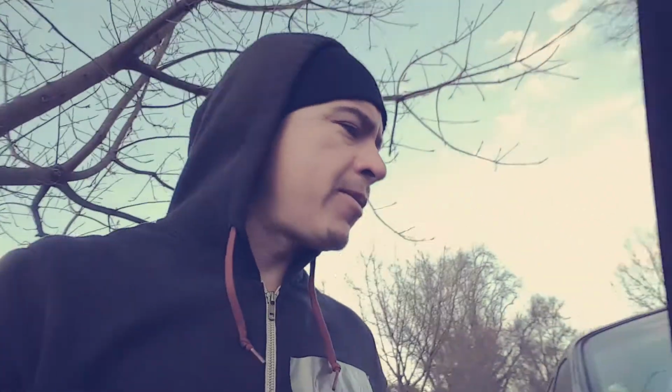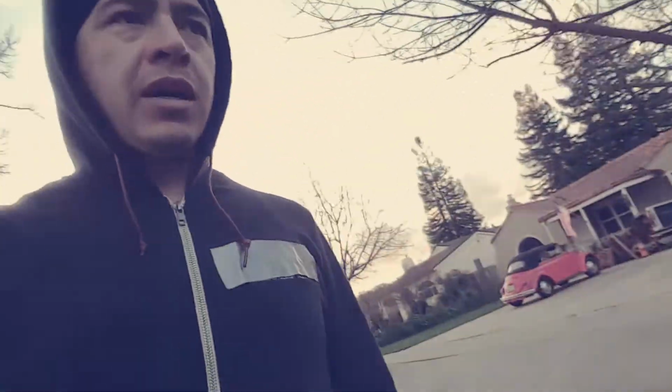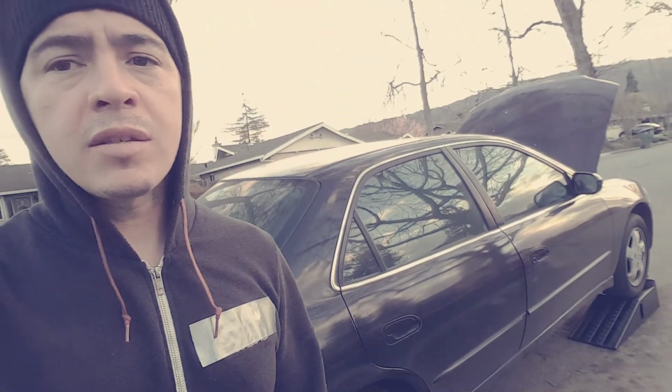See my previous videos, I was talking about doing a sway bar upgrade to the front of my '98 Accord. Now, the Honda community, and specifically the Gen 6 Accords, I don't think anyone's covered this yet, and for good reason. It is a miserable, arduous process getting that thing out. I didn't unbolt wheels. I didn't unbolt anything else besides the sway bar end links and the caps that hold down the sway bar to the frame.